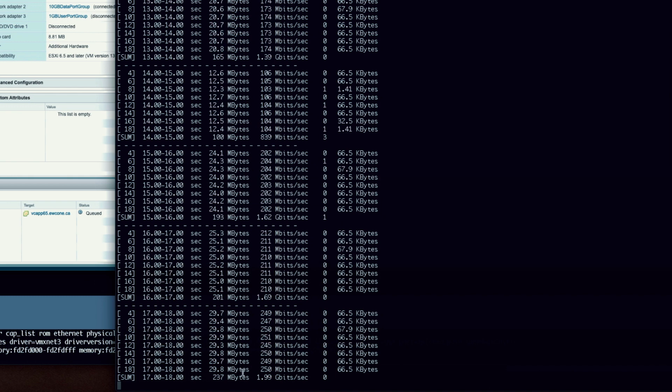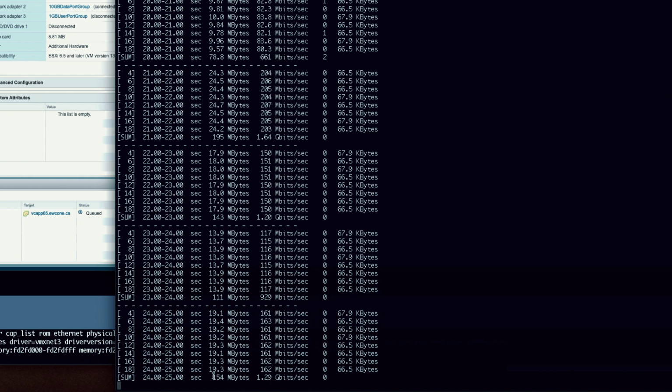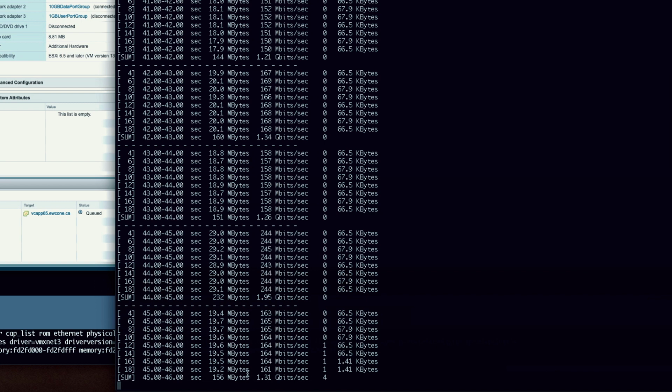But that just gives you an example of how important it is, and it will actually drive your IOPS, unless you don't have the proper power and proper PCI cards inside your machine. See here, it's 1 gigabit per second mostly, and it's not going well. 1.63, and it's mostly driven also because it's the old HP server, but it's also because the IO card is placed in a slot which is, I think, only capable of 5 gigabit per second maximum, and that's the way it is, right?